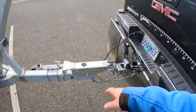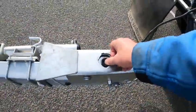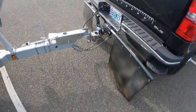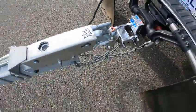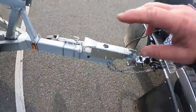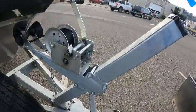This is how you check your brake fluid — I did add some brake fluid when I left. Still full, it was just down a hair. Always cross those things — two-inch ball with the big blue hole so you know when it's down on the ball. Get a padlock for that, get a padlock for your stinger, and if this had a swing tongue get a padlock for that too.